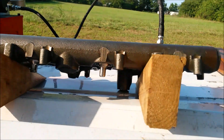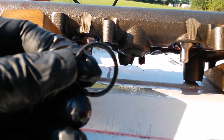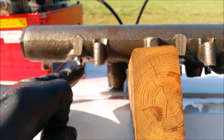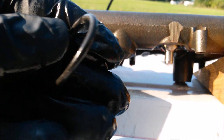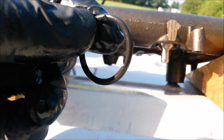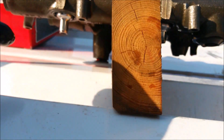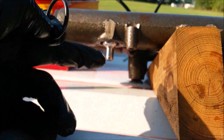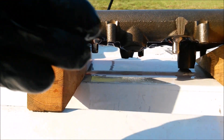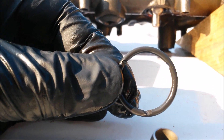In this test today, we've actually spent a lot of time getting this oil rail to leak. We've got brand new seals in each of three different positions: our nipple cup, OEM, and aftermarket. What we had to do is actually cut little nicks in three different places on these O-rings. We tried to get them exactly right on all three, but we ended up having to put a little bit more of a cut in ours because it seals a little bit better. But all three have huge nicks in them, so they're guaranteed to leak.